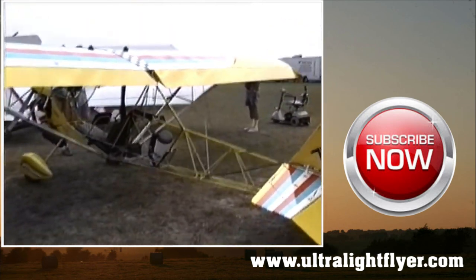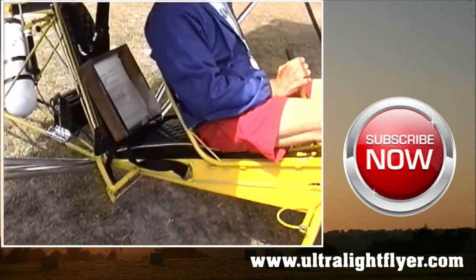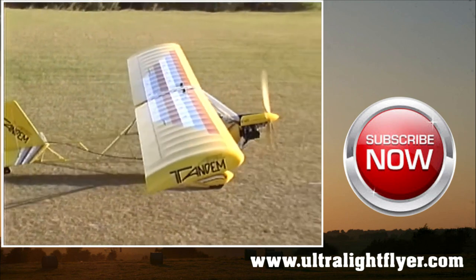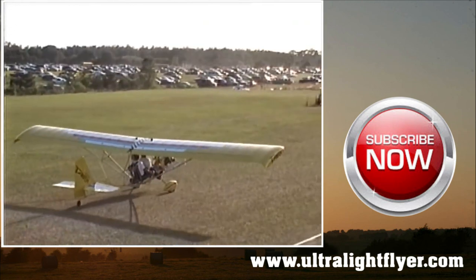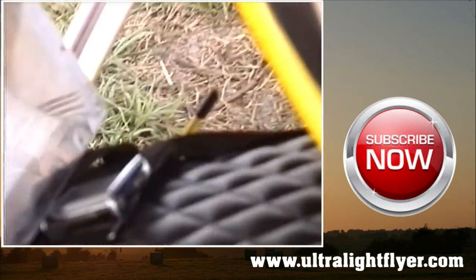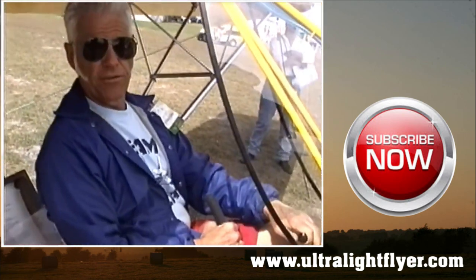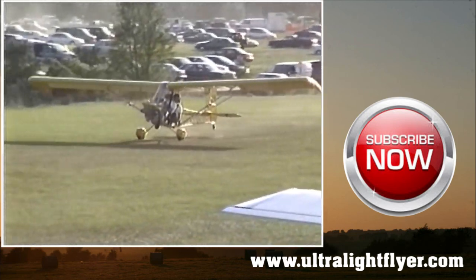Is it dual control from both the front and the back seat? There is a side stick for the rear. When you're flying it, do you fly from the front or from the back? Either way — we've had people who want to fly in either position, and with some heavy folks, we're going to have to move the wing forward a little bit to ensure that a big guy can fly it from the front or from the back. Throttle is right here, and there's a side throttle back here too. The double levers are individual wheel brakes — you can taxi it individually. If you put the student up front, he has them and the instructor will probably learn something.